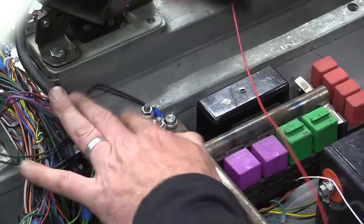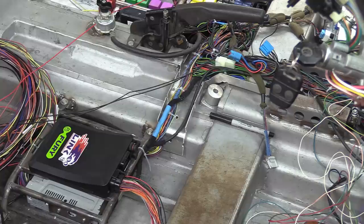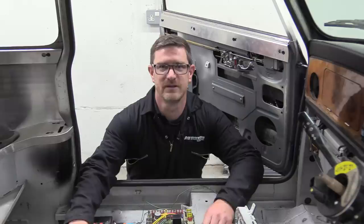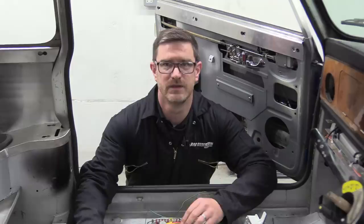Now I can turn on the isolator and then switch the ignition on to see what happens. The blue flashing LED is a very good sign. That's great, we've got power to the ECU, and I'm not on fire. So now we need to get an ignition live to all the components that the ECU controls. And on the MG, that's taken care of by this socket here.